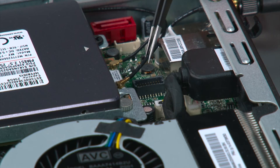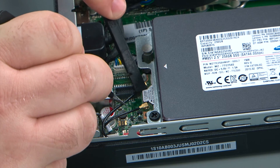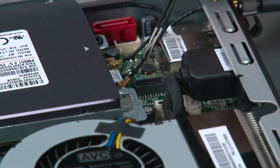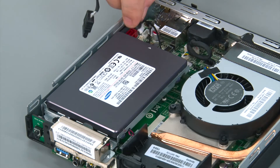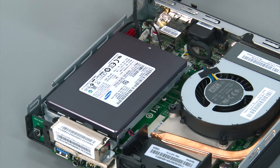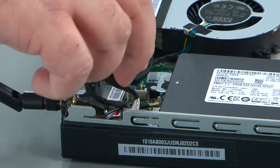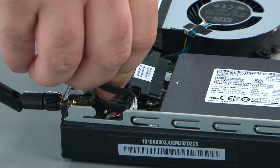Now reconnect the front antenna cable. I'm using a non-metallic pry tool, but your fingers will work just as well for this — it just kind of snaps on like a button. To connect the storage drive cable, connect the power cable to the system board, the SATA cable to the system board, and then connect the cable to the back of the storage drive.